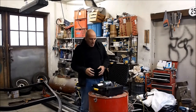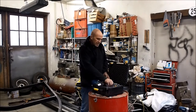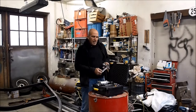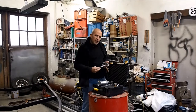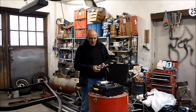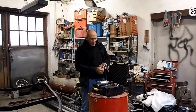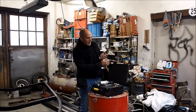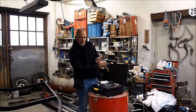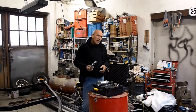A lot of people also ask how to set up the gun. So what I'm doing is, when you have a look at the gun, you can control the amount of air here. It's always fully open. So obviously you have the small gauge here that shows you how much pressure, and there you can adjust your flow. You do not adjust the flow on the paint gun. The same thing here is for the material. Material I always have fully open. And this is the trigger. So what I do is, when I screw it in, I press the trigger, and then I start screwing it in till I hit the end. So now I would actually, don't know if you can see that in the camera, when I start screwing it in, I would start moving the handle or the trigger forward. So when I reach it, I stop. So that's how I set up my gun.